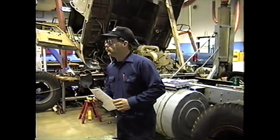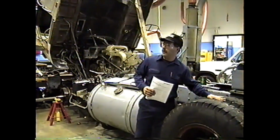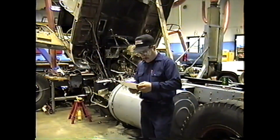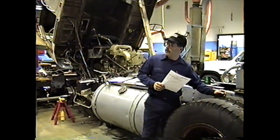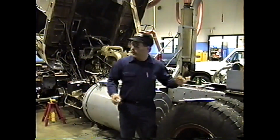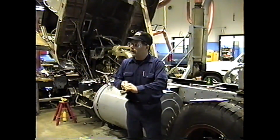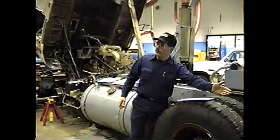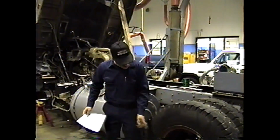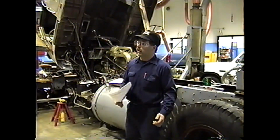Is there a valve stem on here? Oh yeah. They are not connected other than being mounted on the spacer on the hub together. Each one has its own valve stem. Yeah, because then it'd be like just one tire for that one valve. Some manufacturers put a hose from one valve stem to the other, so you have a central place to fill them up. But then there are check valves in there, so if you lose all the air out of this tire, you won't lose it out of this tire. So you want to be careful. Just look at your valve stems before you take it apart, that it doesn't have that connecting hose, so if you're going to pull one off, you don't rip the hose off.